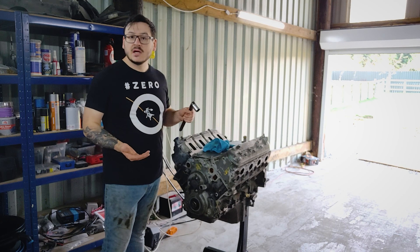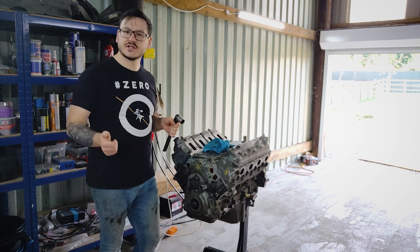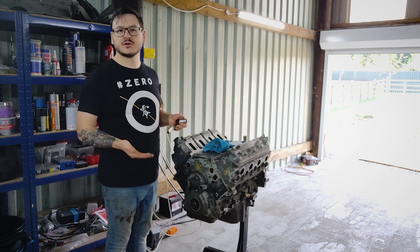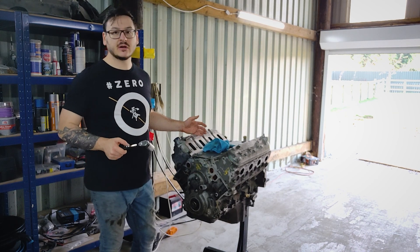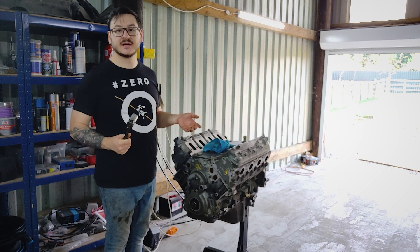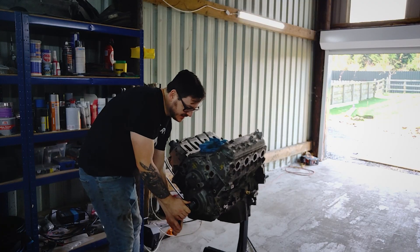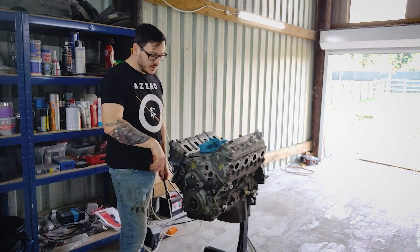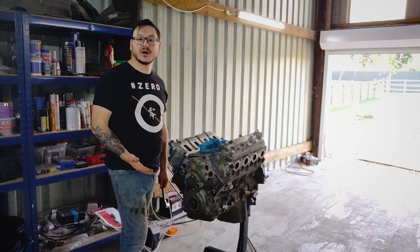Just going to dry it off with a heat gun — doesn't need to be super dry anyway. I'm not too worried about getting every little nook and cranny because we're going to be taking the heads off next episode. So there we have it — the LS is somewhat clean now. I want to paint the block and the heads as well. I'll probably have the heads vapor blasted, and then go over the block once more with brake cleaner and a brush to get the stuff that would stop paint from adhering. I'm not looking for a show car finish — otherwise I would have just bought a crate engine. But as I mentioned, we will be taking the heads off in the next episode. Previously the engine turned over absolutely fine, but let me show you what happens now — it turns over, turns over, turns over... stuck. There's something stopping the pistons and the crank from turning over. Wind it all the way back, roughly the same point — stops again. So there's obviously something in the engine stopping it, which didn't happen previously. We're going to pull the heads off, so that should be a bit of fun.